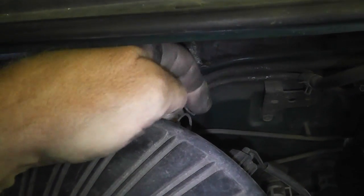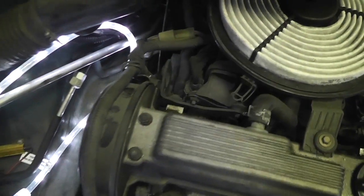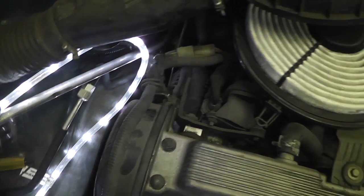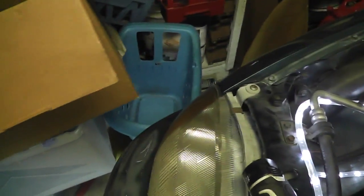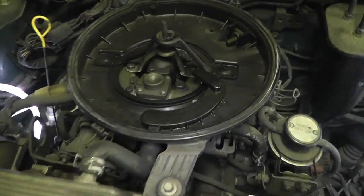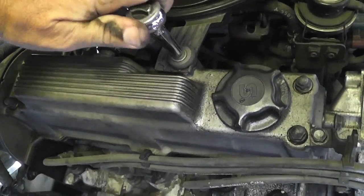It's a little harder to do one-handed. This guy's already unhooked — this is gonna pop off, which is really straightforward. So I'm just gonna loosen this hose clamp and disconnect. I did that one-handed so that was easy. And then here's the air cleaner — pull that off. This nut right here we're gonna need to take off; turns out it's an eight millimeter. No problem.